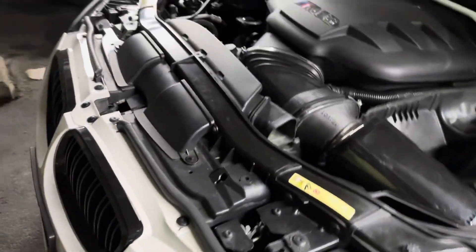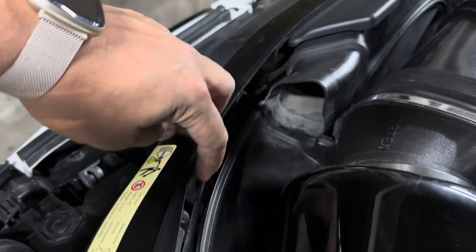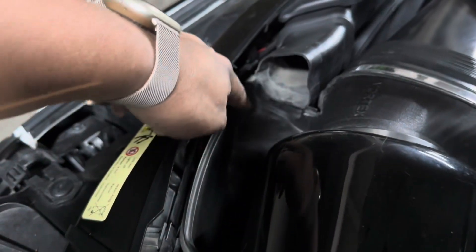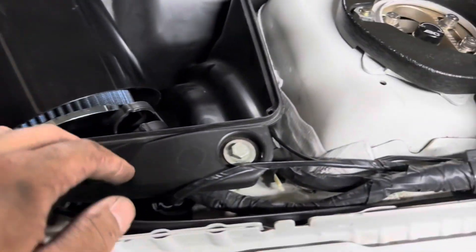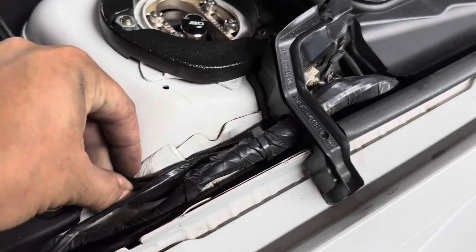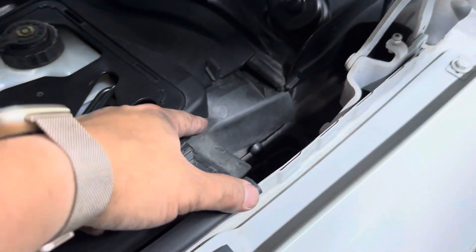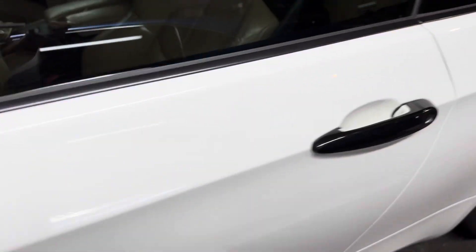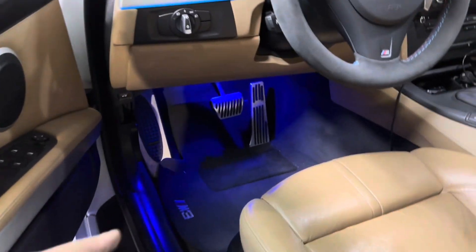The front camera is installed. The wiring is mostly hidden — you can see a sliver of the red wire but it's tucked underneath the air box, best I could do to hide it. It's grounded over here, and the signal wire is this one right here, following along and going under the cowl into the firewall.